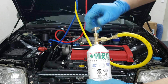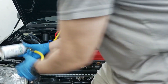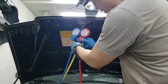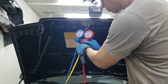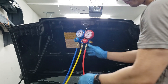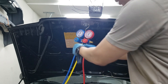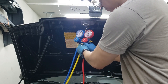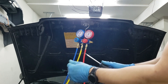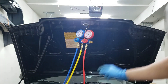We're going to pierce this can now. There you go — you heard it activate. Now we're just going to get a screwdriver and bleed that out of the system right here. Make sure you don't get it on yourself. There you go — refrigerant's coming out, we've let the air out. You can feel it's really cold on the hands, so make sure you wear gloves when doing this.